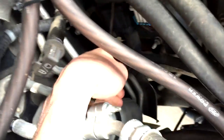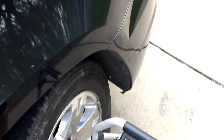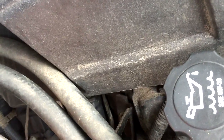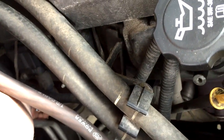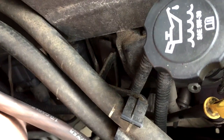You're going to get cut up by the heat shield down there — I'm sorry, guys, but you will. I recommend a step ladder; I'm 6'3" and I'm still using one, so it's not just a small-person thing. You come up on your step ladder, pull back around the heat shield, and feel for where your plug is. Every plug is going to be in the same spot, then you simply slide this right over it.